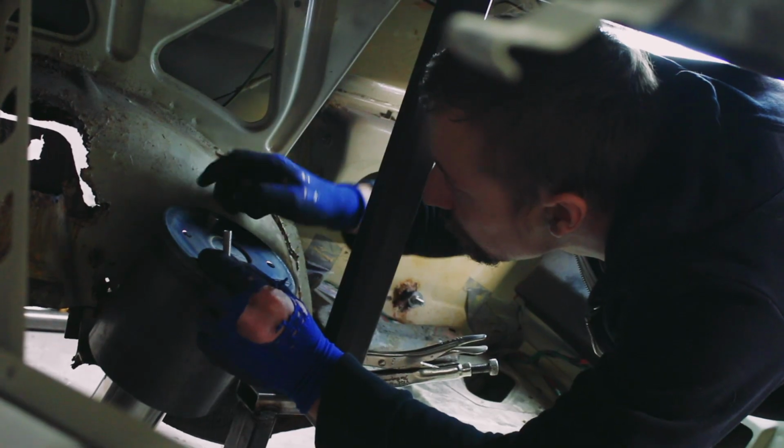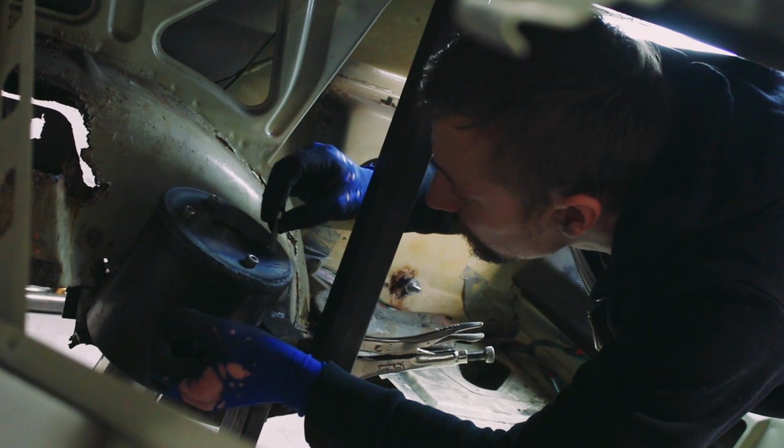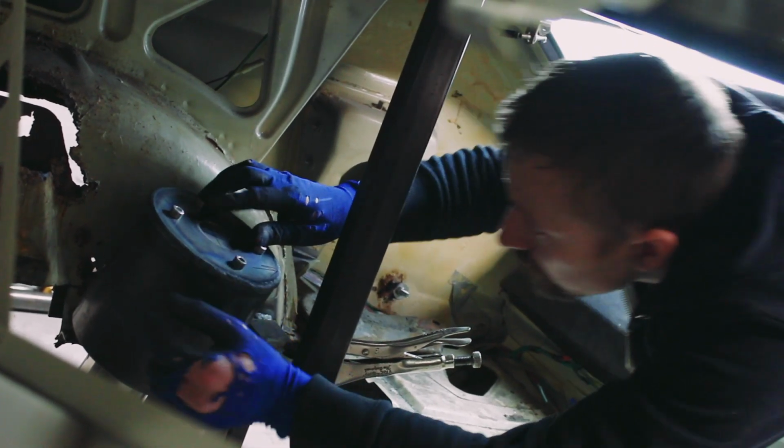I don't want to go too far ahead on wheel arches until we've got the actual wheels and tyres on the car that we're going to use. So, like I say, if we're going down the banded steel route, I need to really get those done, because as much as I can measure, it's not the same as having the actual thing in front of you. So yeah, what we're on with now is just trying to get these bolted in, get them welded in with some permanent and some temporary bracing, and then take our jigs out and put the subframe back in again.